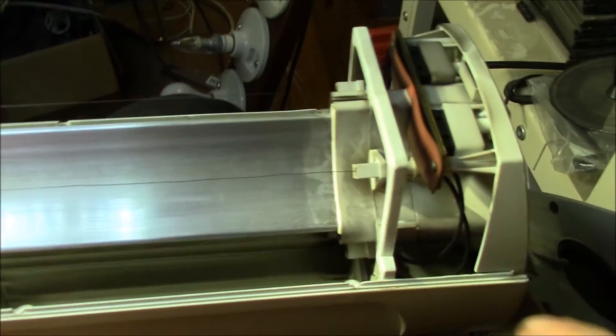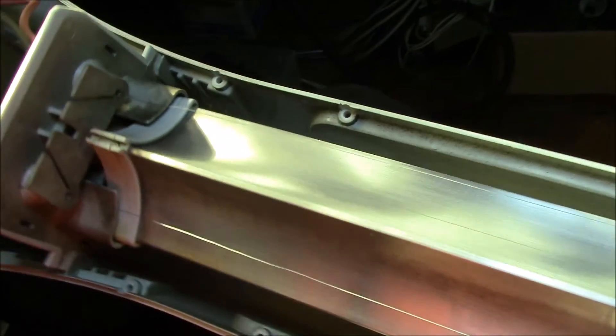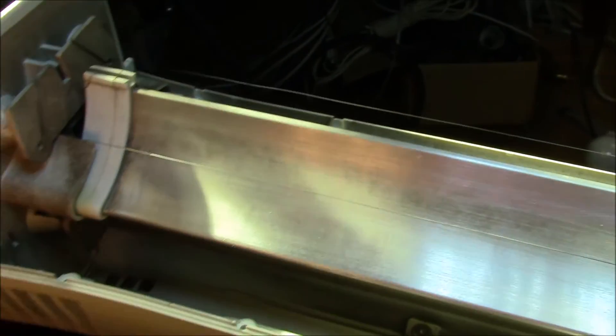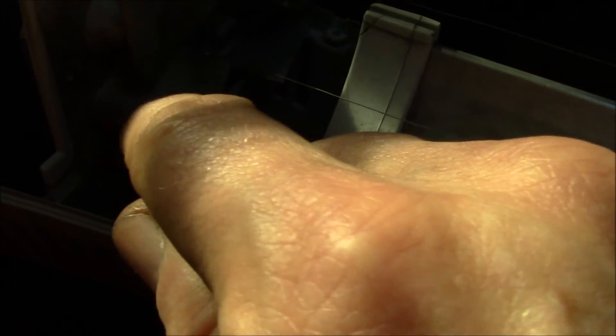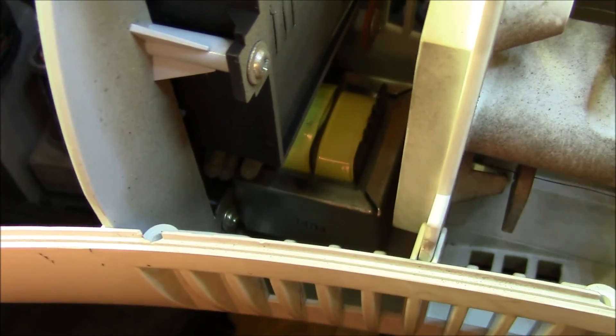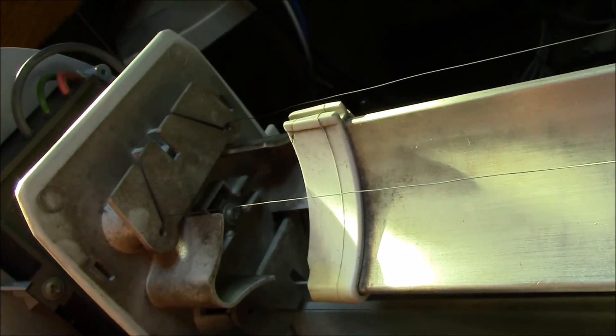We got the front cover off. There were a total of twelve screws — ten Phillips head and two triangle head screws. Down here you can see the center section metal and the wires. It might be enough dust on these insulators causing the issue. This looks like the high voltage supply — here's the negative cable to the center, the black one, and then the red goes over to the corona wires.